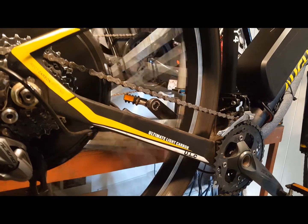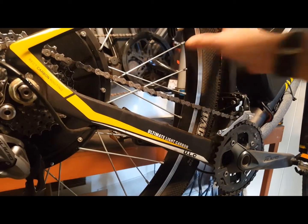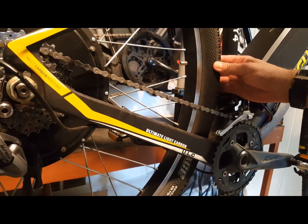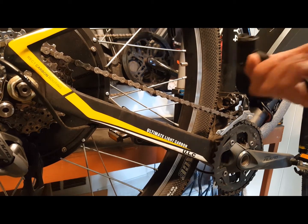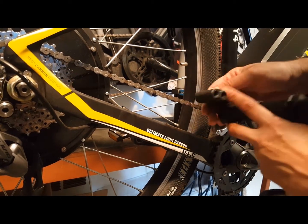An often overlooked maintenance tip on e-bikes is tire pressure. The bike is overall heavier and therefore is absorbing more pressure on each ride. It makes it even more important to constantly check by touch whether your tires are inflated. Get a good pump that works with both Presta and Schrader valves. Those are the two standard valves used in inner tubes.